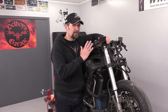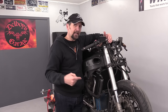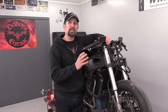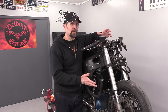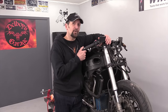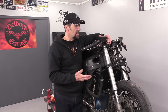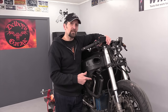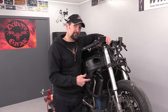Completely bone dry as you can see — nothing in there whatsoever, nothing in the pump, the hoses are dry, and the calipers at the bottom even more so. There's not even a residue because they were completely rebuilt from scratch with new pistons and seals. So this whole system is a perfect candidate to show you this easy trick. All we're going to do is use gravity to prime it up — top up some fluid, take the hoses off the bottom, and let physics work for us.